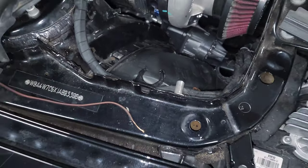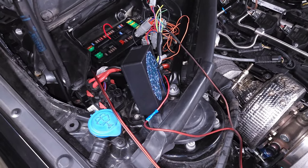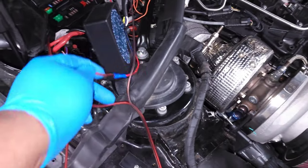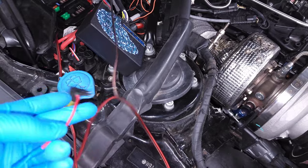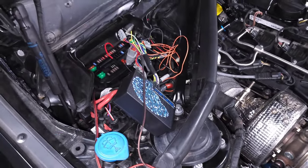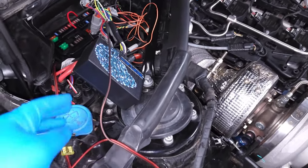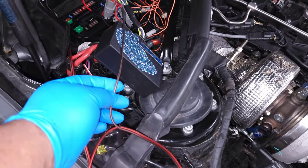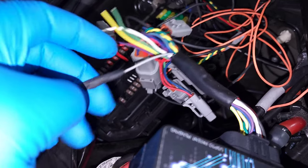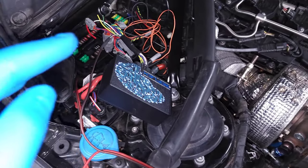Now you're good to go to finish up your wiring. Here's everything wired up. A lot of people have been asking me how to wire this up to a Motive Reflex, so I just want to make sure this is as clear as possible. You're taking those two wires coming from the back of your car — the red switched power wire is going to a switched power source in your fuse box. You can use an add-a-fuse and identify a fuse location that has switched power, or you can tap onto the switched power wire for the Reflex itself, which is what I ended up doing because it's a little bit cleaner. The ground wire is what's going to go to your trigger — on mine I connected it to Aux 2, which is the gray wire. Just make sure you coordinate that with your tuner so they can trigger it properly in your Motive Reflex.